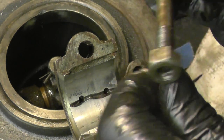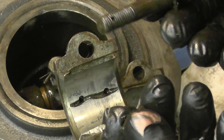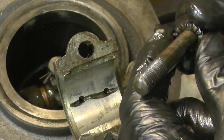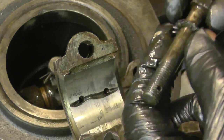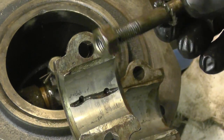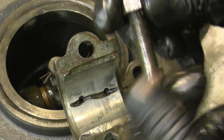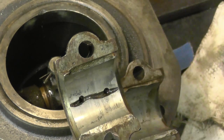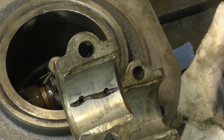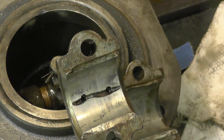They're the big end bolts, 3/8 BSF. I've got a split pin hole through and a shake proof washer. And now we just have a bolt going straight in with nothing retaining it, a stretch bolt just tightened. I think when they did this, they believed in belt and braces.